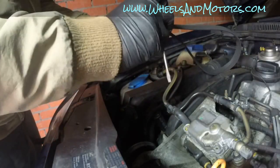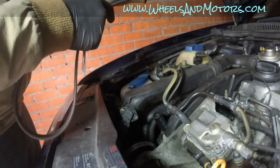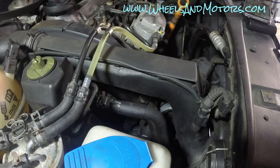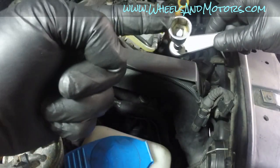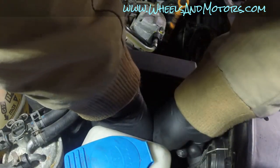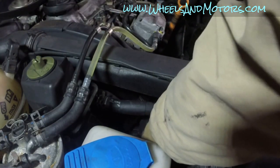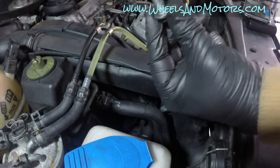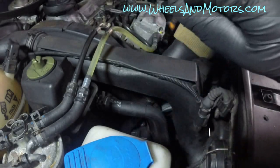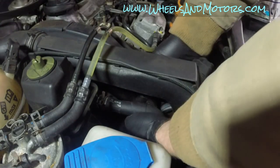To fit a new belt, there's a link below the video to my website. You'll get some images and diagrams. I've got the diagram showing how to fit the belt around all pulleys and rollers. So let's go back to that tensioner. Take a 13 millimeter socket and remove those three bolts I showed you before. Once you break them loose, you can finish by hand. These are bolts. So with the third bolt out, which is longer than the other two, you can take your tensioner out.